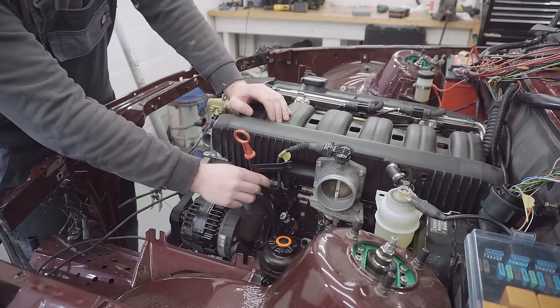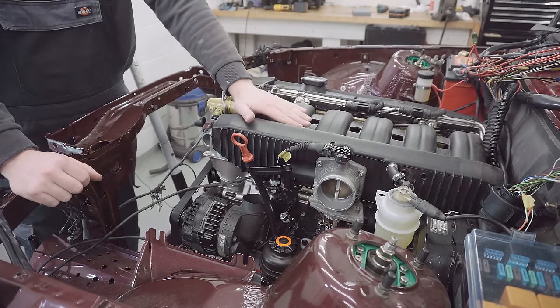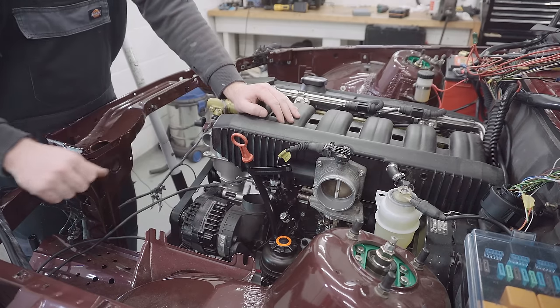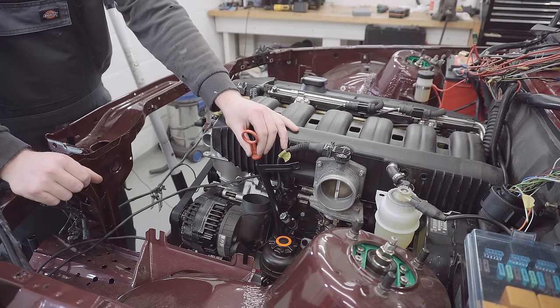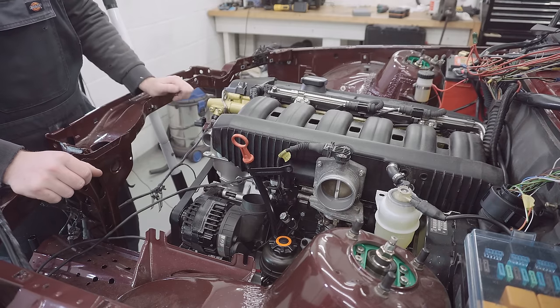My current plan is to start by pouring the correct 6.5 litres of oil into the engine, see if it reads onto the stick, and if it does, use that as my correct level. But if it doesn't touch into the oil, I'll have to come up with a different plan on another day, maybe shortening this tube somehow, but not for today.